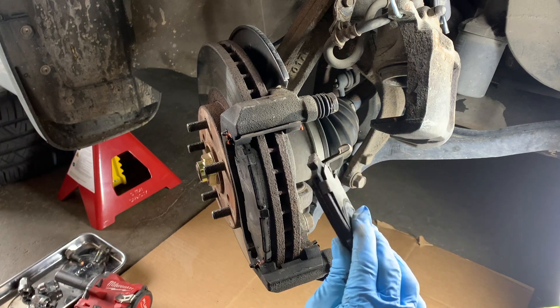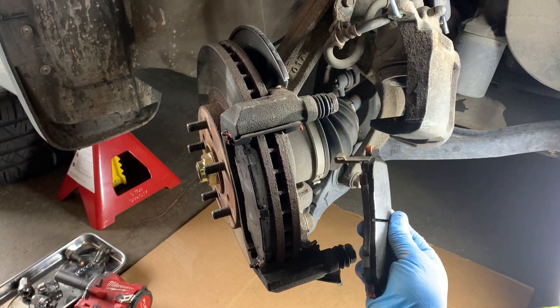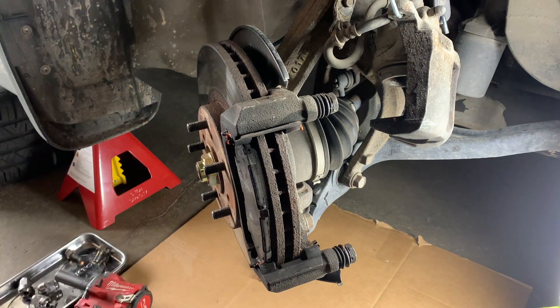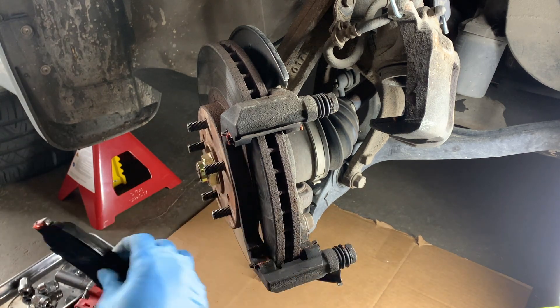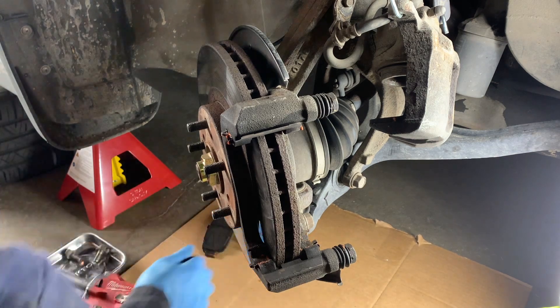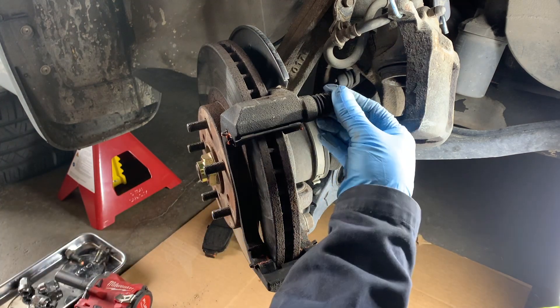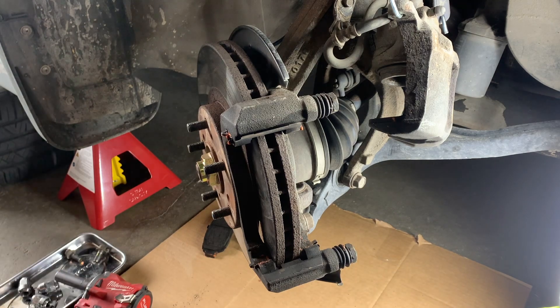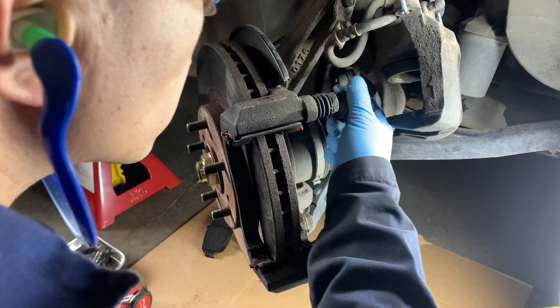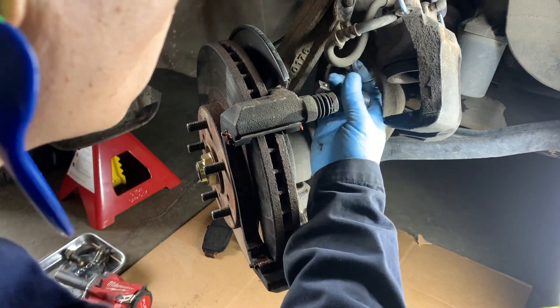Remove the brake pads. I tend to look at stuff just before I put it away — the squealer is going to go on the top inside, and I noticed that. It's good to pause a little bit as you're doing this so that you can observe the parts you're replacing, how they fit in there, what bolts you're supposed to be using. Those things leave you clues and if we pay attention it makes it a little bit easier to put back together later.